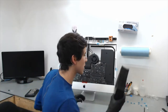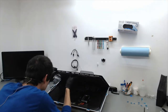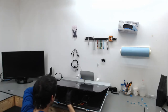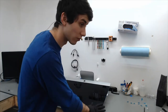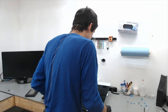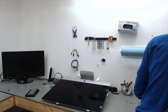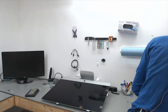Before I lay it down we remove our iMac stand and set this back on its back. I have my LCD all connected onto the logic board, and before I pick it up I'll take some Kapton tape — a type of electronics tape that doesn't leave any residue behind. I'm going to tape up the sides and the top of the LCD so I can pick up the iMac without fear of it falling forward, and we can do a quality control test before we remove the adhesive strip pull tabs.